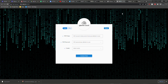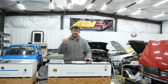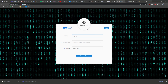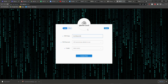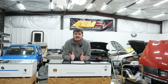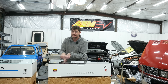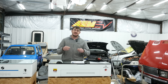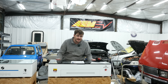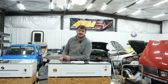Then you enter in the name of the Wi-Fi network you want the machine to connect to — manually. You'd expect it to scan local available Wi-Fi networks and populate a dropdown list, but no, you've got to enter in the name manually. And according to the instruction manual: 'Note there is no space in the Wi-Fi account name. If there are spaces in your Wi-Fi name, please remove the spaces when entering the account.' That's just simple whitespace filtering — you couldn't do that for me? Once you've entered the account name, making sure it's correct and case-sensitive, you enter the password, select the region, hit connect, and it's supposed to signal success by turning the light off. That's the part that never happened for me. I tried about 20 times and could not get it to connect — but maybe it's because I have a space in my Wi-Fi name.